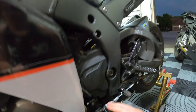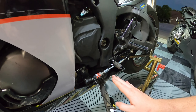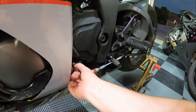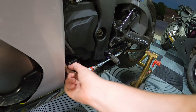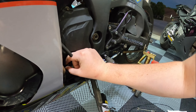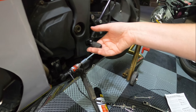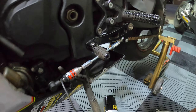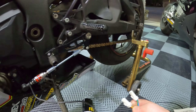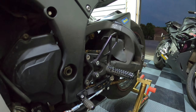For your sensor, you're going to want to identify if you're pushing or pulling, and that will vary based on how your shift rod is set up as well as if you're normal or GP shift. I'm normal shift, and this only works upshifting — not downshift. So when I go to shift up, it's pushing the sensor. So this is a push type. I want to use the push type pin, which is the green and blue, and I'm just going to ignore the other one. That one's for if I was pulling, which in this case would be if I was GP shift.